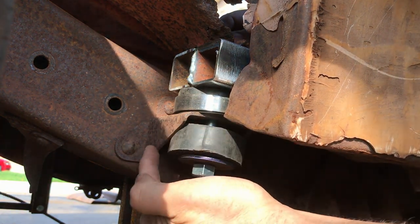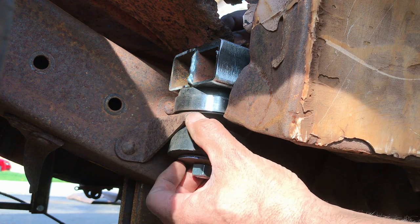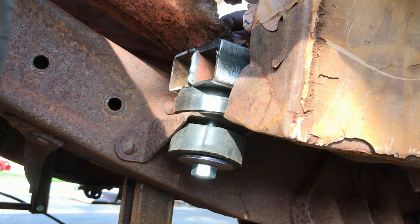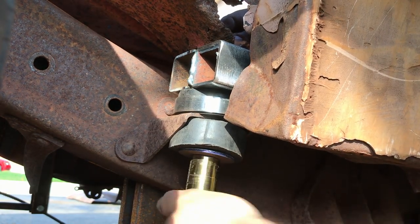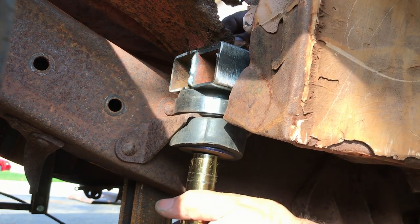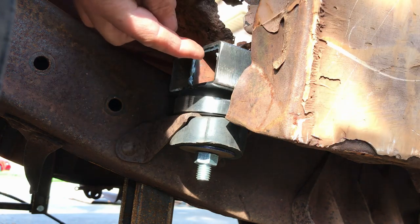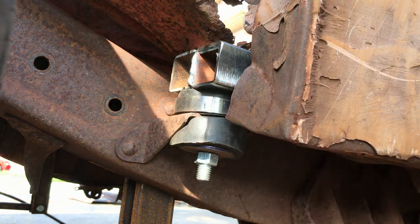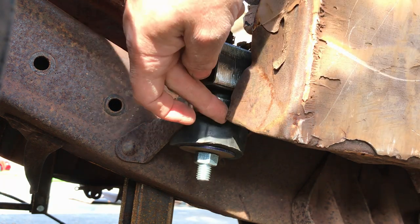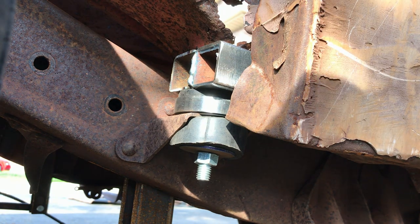So I still have to extend this plate out. I'll make a nice rounded extension onto this, because I know that this rubber is going to bend round, squish round that edge, until I have a flat plate for it to go on. See what I mean? So that's all lovely. Now I can tack this in place both on the floor and on that beam that it's flush against, and then take it all off and weld it on properly. And while I'm doing that, I'll weld a little extension onto this. I like it though. Just need to do the same at the front.